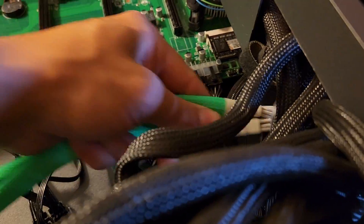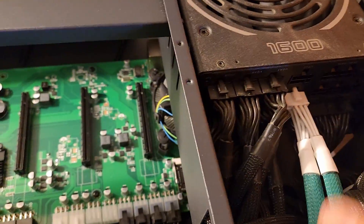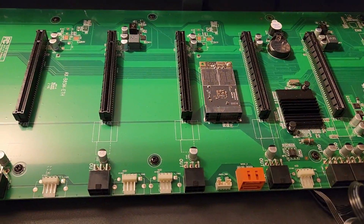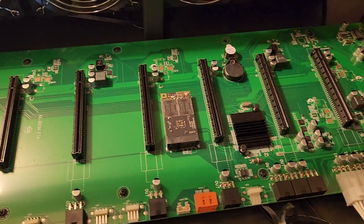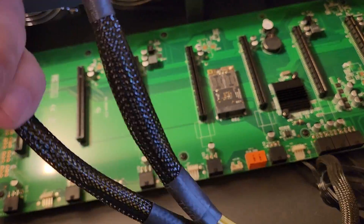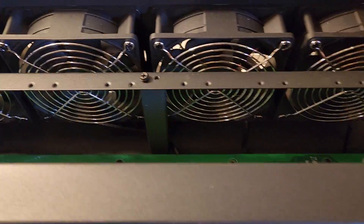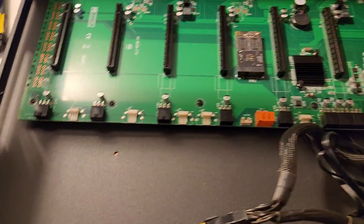He also has different shades of green which is Crewman's color. As you can see you're basically using everything on the power supply except the 24-pin, which you have to jump — when you turn it on it'll pop everything on, so you don't really need an on-switch. On this cable we split the six-pin onto the fan controller which controls four fans, and then have two connectors for the 3070. Remember, you don't have to buy the eight-fan version, but it was only $10 more than the four-fan and seemed like a no-brainer. The server case is built.